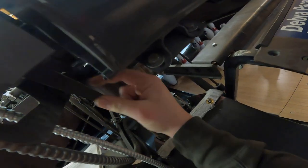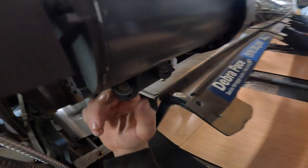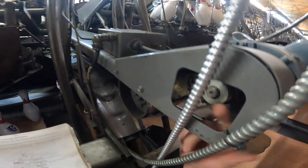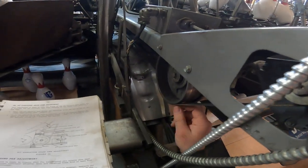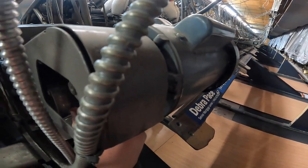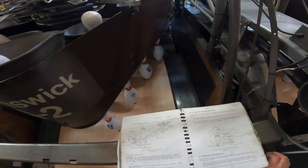I don't know what they're talking about with that. You can move the motor up and down on the mounting plate, and you can also move the pulley on the shaft. I don't understand how moving it back and forward or adding shims is going to make the belt move side to side. Mine are all over the place and they all work fine — some on the edge, some three sixteenths from the edge, some a quarter from the edge. Like I said before, all these adjustments are for new parts, and I don't have new stuff.